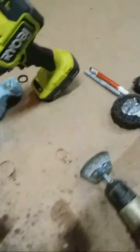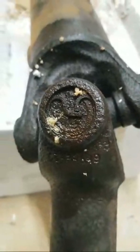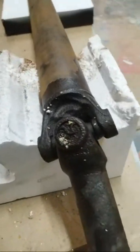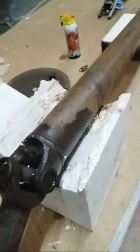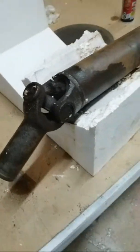I've been using these strippers here, and they took off a good chunk of that rust. And you can see this stuff looks like it's the Titanic. It's been there so long. So the bearings are all good. They have a nice swing and range of motion. They probably would have lasted another 50,000 miles, but while I had it apart, there's 3 bearings at $70 for the bearings. A little bit of aggravation on my part.